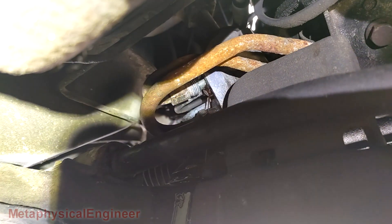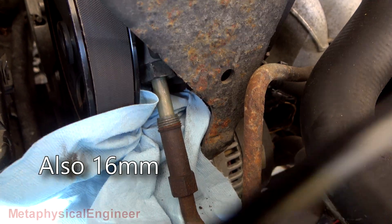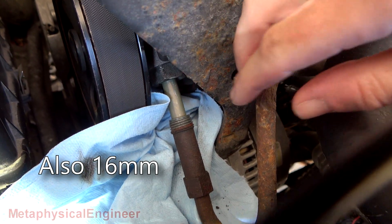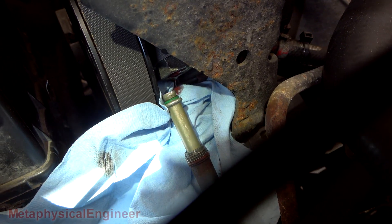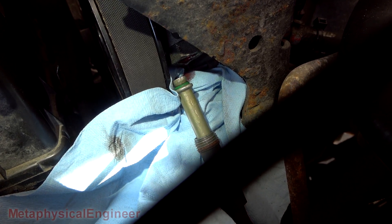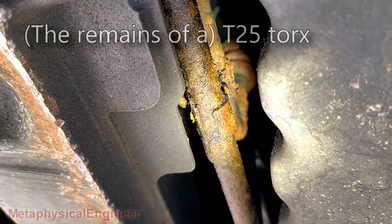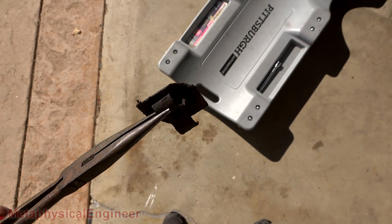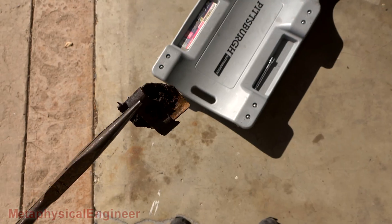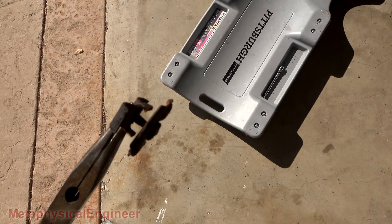With the next bit of wiggle, the o-ring pops out of the steering rack and the fluid drains out of the high-pressure line. Almost identical configuration up top except for a longer nut for better access around the pump and its bracket. This should likewise pop right off — small amount of dribble from the pump. Most everything else should have drained by now. One more retainer up here holding the lines together, buried in the corrosion. Getting this last clamp off the lines was a protracted battle — that took the longest out of any of the steps so far. I'm filthy, the head on this is almost stripped, and I'm not going to use it again. I'll find another solution.